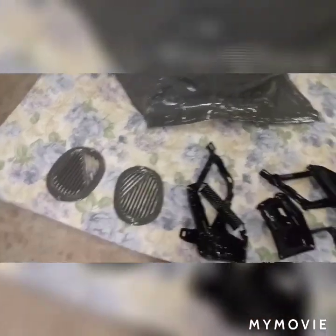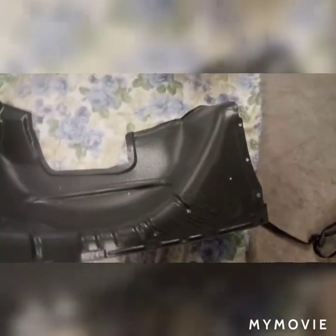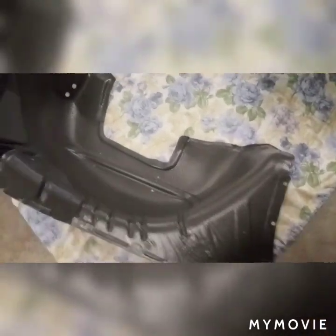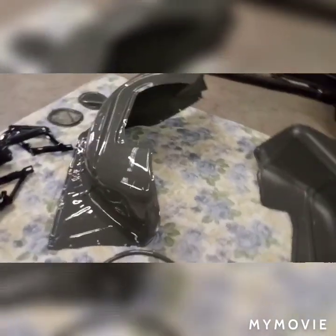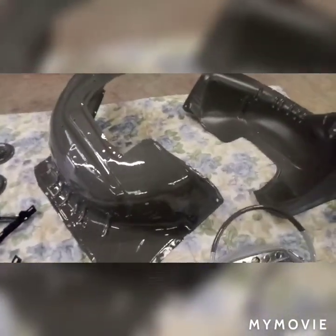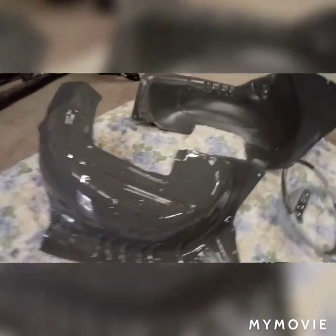Same with those vents. The wheel wells, those were in epoxy as well, so we just scuffed those. On the bottom, it's reduced Raptor, color matched. Reduced it to give it a little bit less texture. And then on the top, we scuffed them 400 dry and a sealer coat of epoxy, and then 2 coats of base, and then 2 coats of that production clear.